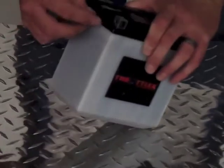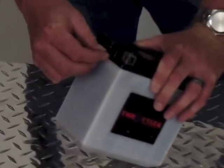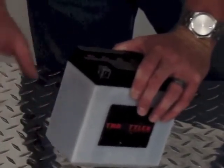On the conventional style battery you'll also notice that it has a vent tube, and the chances are that your vent tube is hooked up. Make sure that there are no kinks or binds in it and that it does port out to the proper spot on your application.